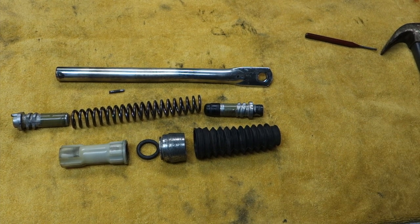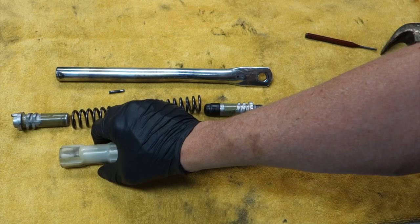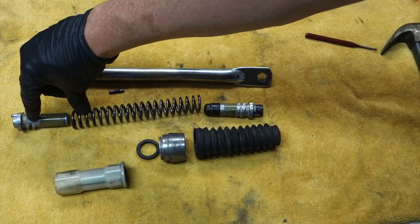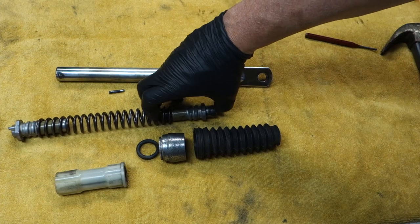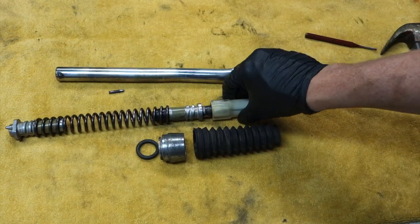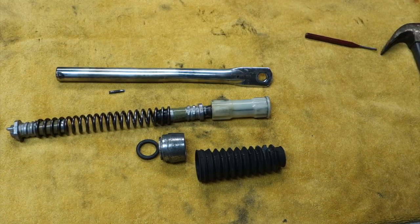I bought some new internals that are complete — they were sold in a pair, and I'm going to go ahead and install those right now. Make sure when you're putting these together you want to grease this guide, and I also greased up the spring area and this area when it's all put together. So grease on this guy, the area where the spring connects to this bump stop in the top section. Then you can slide them into place.